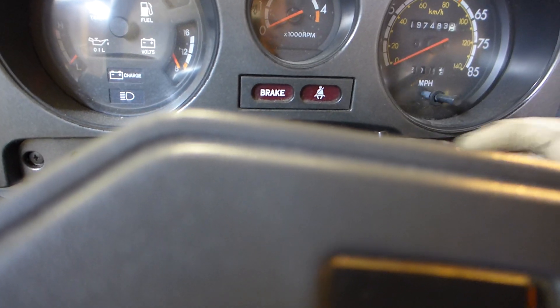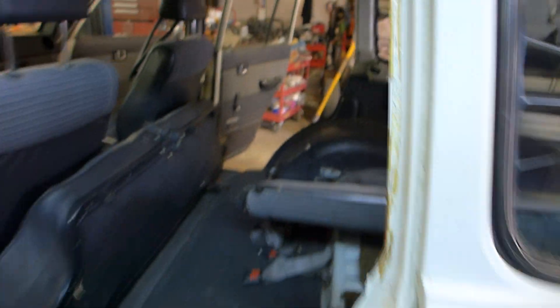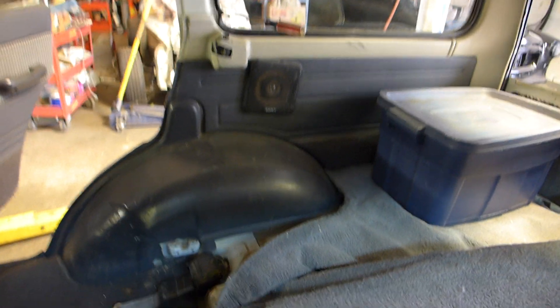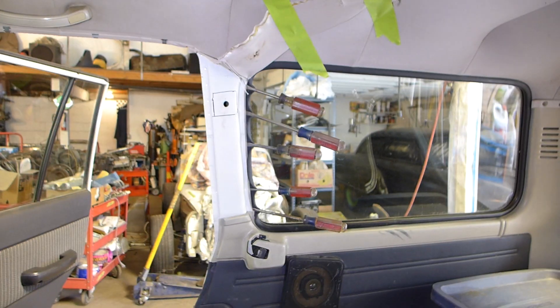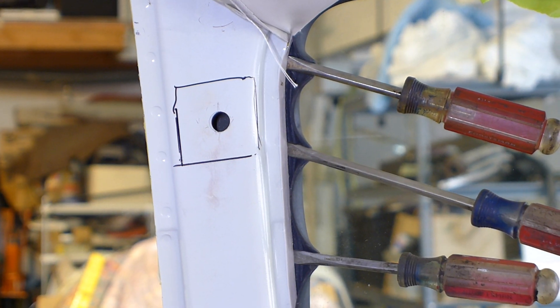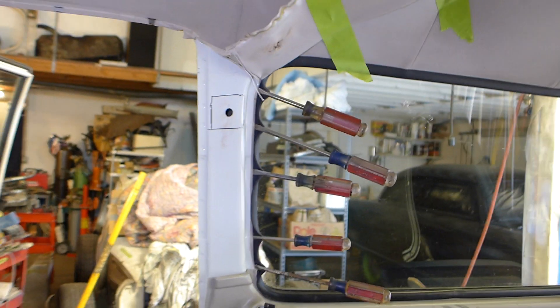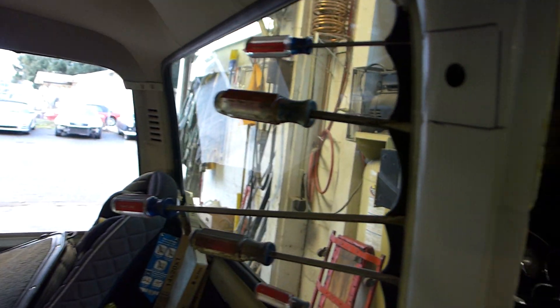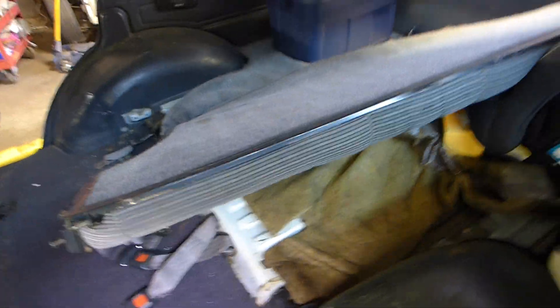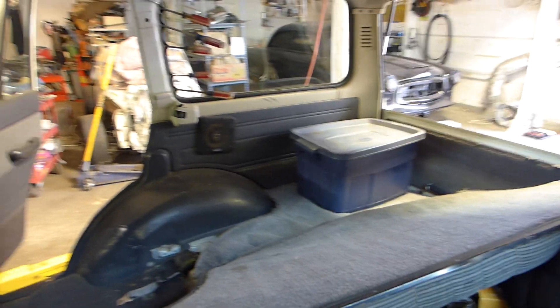What we're doing today is a tune-up, and something else in the back. This is an '86, and it never came with three-point seat belts in the rear. This family has young kids, and you can see my screwdriver poked in that hole in the C-pillar — I've made a square around it. I need to put a reinforcement plate there so we can mount three-point belts; otherwise it'll just pull right out of the hole. There are no threads, nothing. I'm going to weld a plate with a captive nut so we can bolt the three-point belts on — a retrofit to bring this car into the modern era.